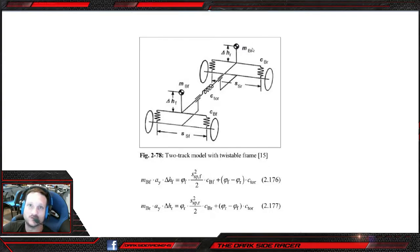So when we were talking yesterday about GT3 cars that have very limited spring package combinations that you can possibly find, that the balance of power limits the cars to, one of the ways that you can get the rear of the car to roll over more to match the front roll of the car is ride height. So that's how that works, and I kind of wanted to come back and visit that,